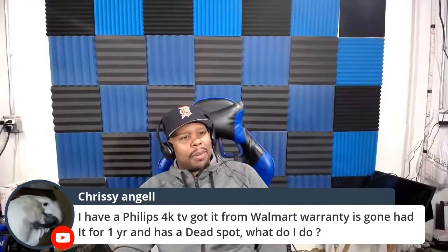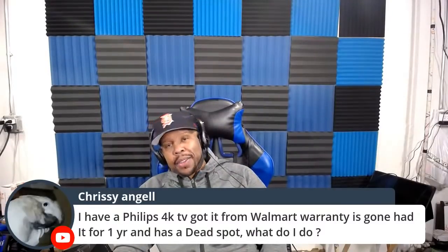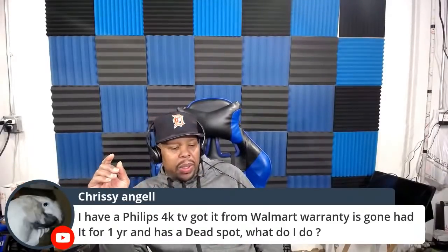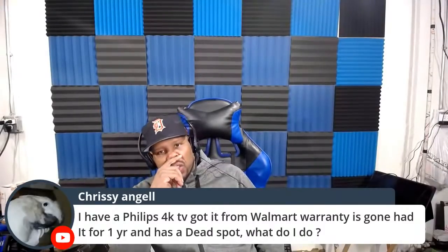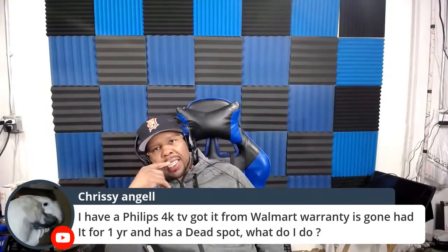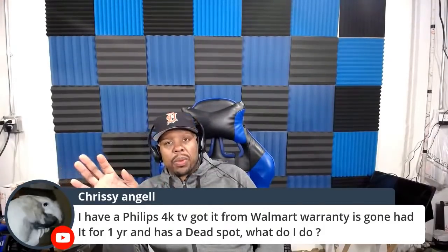Well, Chrissy, I'm sorry to hear that. You may have to eat that, or you might have to unplug it, open that bad boy up and look for some capacitors. They look just like batteries. And it could be that one of them is oozing. I had that same issue. It was spotty, but then my Philips TV started cutting off. It wouldn't stay on. So when I opened it up, I actually watched YouTube. First thing I would tell you, to find whatever model you have, YouTube it. See if anybody else is having any problems with that TV.